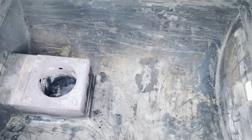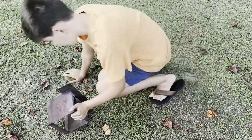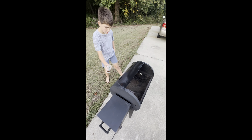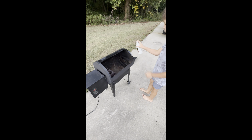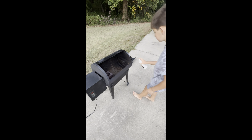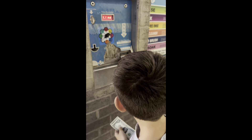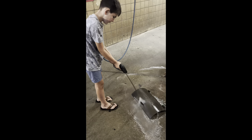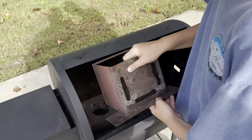Here Elliot's hitting the hot box cover with a little bit of sandpaper. Now we're starting the painting process — holding it away from the grill and just laying three to four layers down, letting them dry as they get put on. You don't want run marks and you don't want things to be caked up. Using Dawn Power Spray and your general oven cleaner — you can get at basically any general store — to help break the grease and grime buildup off of the lid. Then we take it to the local car wash and give it a good pressure wash and scrubbing.